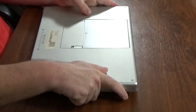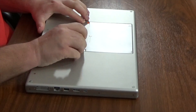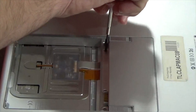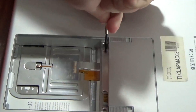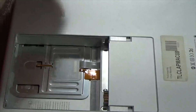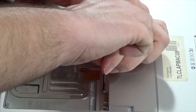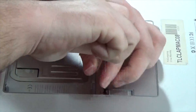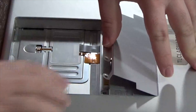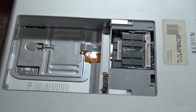Your first step is to remove the battery — flip the MacBook Pro upside down and remove the battery using the two little release latches. Next, take off the RAM access panel by removing the three Phillips screws from the RAM panel; they're all the same size. Then lift off the RAM cover. If all you want to do is upgrade RAM, congratulations — you're at this part.